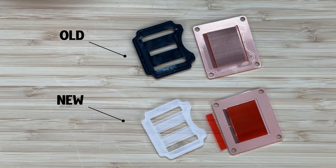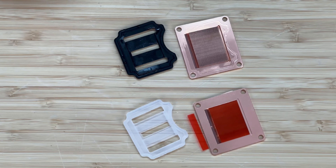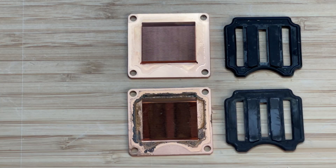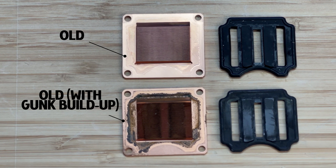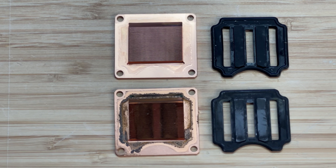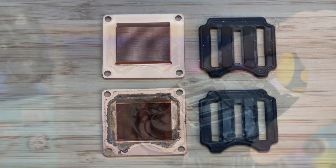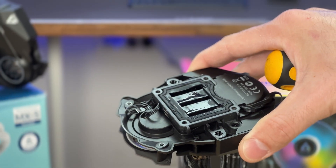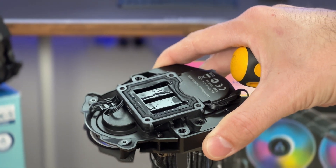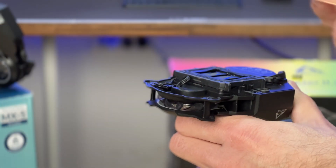The service kit solves the issue and it's quite easy to change. The Liquid Freezers affected are those produced between May 2021 and March 2022. The issue is they weren't vulcanized properly, causing a chemical reaction between the copper cold plate and the gasket, resulting in residue buildup and performance issues.